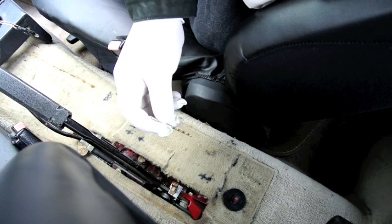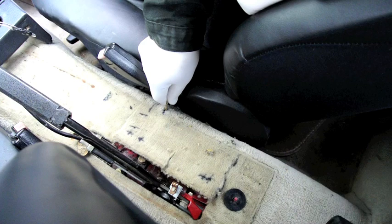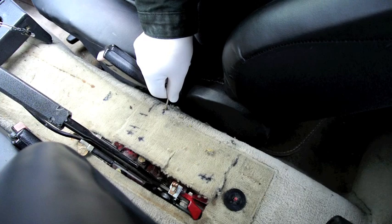This is basically the sketch of the drilling. You're going to use a small drill bit first as a pilot drill and drill one hole through the carpet all the way through at ten and a half, then the second one at sixteen, and the third one. For the second hole you're going to go at about 45 degrees — not at 90 degrees, but 45 degrees.